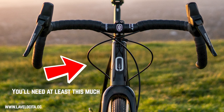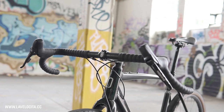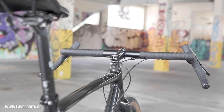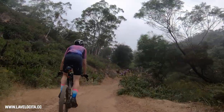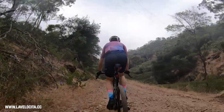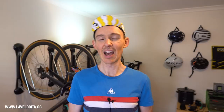There are a few logistical hurdles with such an insanely wide bar. For starters, you may have to fully re-hose and re-cable your bike — you need a huge amount of slack. Luckily the bike I put them on had just enough, though the mechanic did have to let the brake hose pop out of the bar tape a little earlier than a full wrap to make it work — pretty touch and go. Bar tape can also be a problem; Curve does ship extra-long bar tape with each set, which makes it usable. Once fitted though, these bars are really comfortable and give you tons of control — especially in rough terrain and trail networks, where the wide body position similar to a mountain bike gives you heaps of confidence.